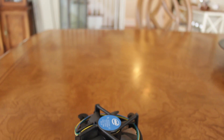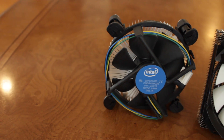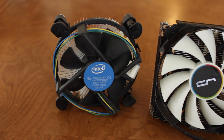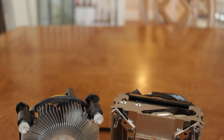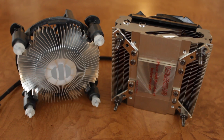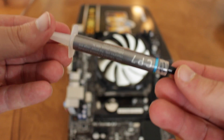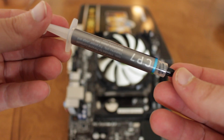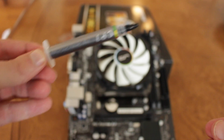I decided to compare this cooler to the stock Intel cooler, as that's honestly its biggest competitor. They're both sized similarly and are guaranteed to fit. The biggest difference is that the C7 includes copper and the stock Intel cooler does not. The copper in both the base plate and the heat pipes allows for much more heat to be dissipated than using aluminum alone. Additionally, the stock Intel cooler uses pre-applied thermal paste that's been sitting around for who knows how long. With the C7, you get a sizable tube of thermal paste good for covering around half a dozen CPUs, so if you ever want to move the cooler or reapply paste, you have the ability to do so.